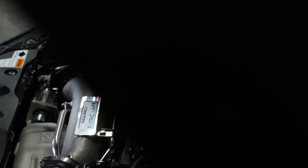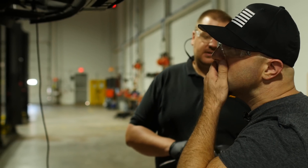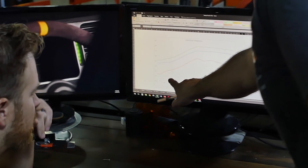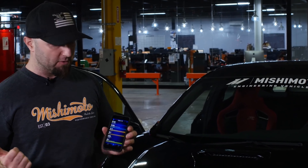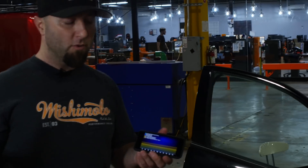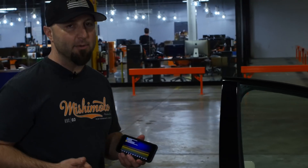With the car being so new, we wanted to capture all the OBD2 data that the ECU is seeing. We couldn't capture that on some of our data access systems, so this BlueDriver is what we've been using — it captures everything on the iPhone. All the channels this car is outputting we can see, and we can also send them off into an Excel spreadsheet and read it after we've driven the car and compare it to our AiM AQ1 data. We use this device while logging to see the global effect of the cooling system and all the factory parameters the ECU sees.